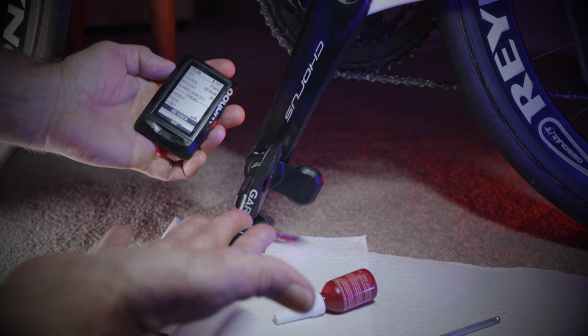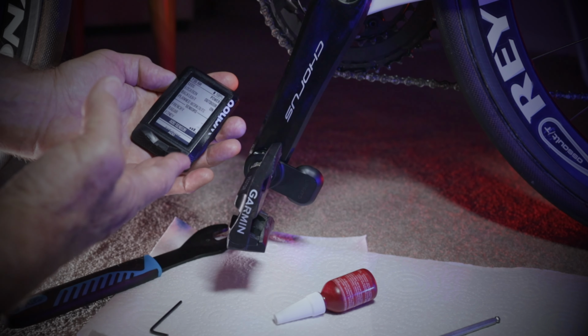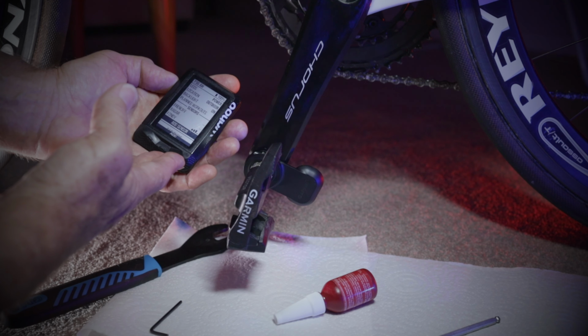So now we have the pedal is on, it's been torqued up to 40 newton meters, the pod's connected, and the Wahoo has detected it. So it's all ready to go. Well, guys, thanks for watching. And I hope you learned something from that if you've got some Garmin pedals. And that's how it works. If you get a broken pin or a broken damaged ribbon or something like that, you can use the wider pods. Thanks for watching.